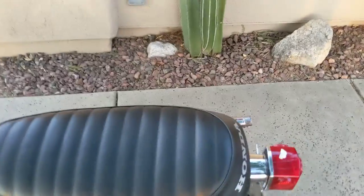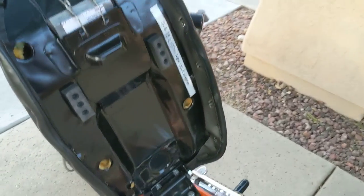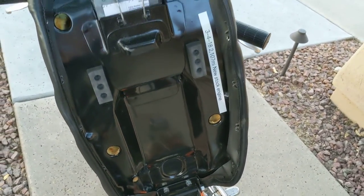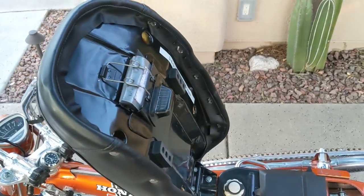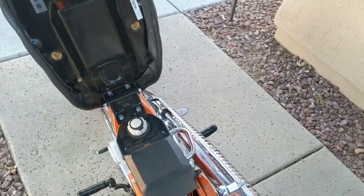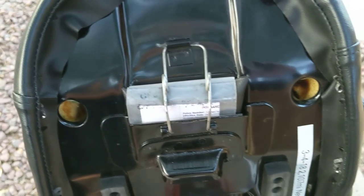The last thing I did here is the seat. This is an original seat pan. All the bikes I have, I make sure we have an original seat pan. This has been powder coated and then recovered using the original foam. The original foam on these bikes is latex — it's a little softer and I like it, and it was in decent shape. The original tool kit is in place also, which is nice.